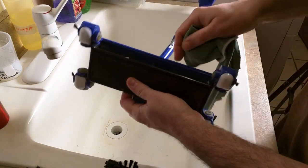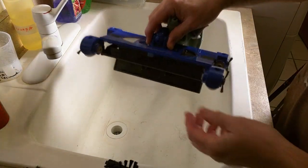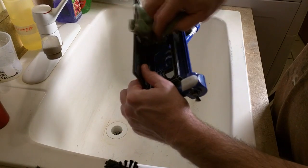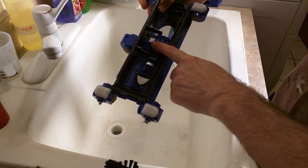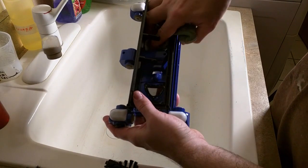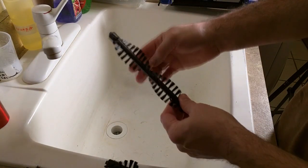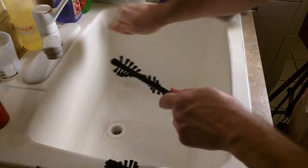You want to wipe those little angled sections off — the camera is having a hard time picking it up because it is black. Then push the two tabs in and that releases the dust tray. Empty the dust out first, then take your damp cloth and wipe it down. Sometimes you'll see little staples and metal pieces on there because there is a magnet in here from the motor which will collect anything ferromagnetic, so you want that to be nice and clean. Get the inside as best you can, shake it out, and once you've cleaned the outer portion, you can take your hand and pull the hairs off the bristles.